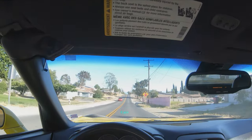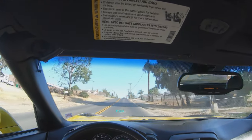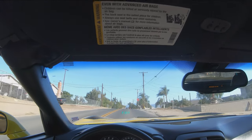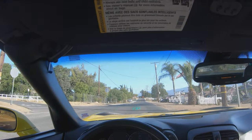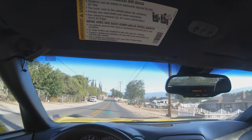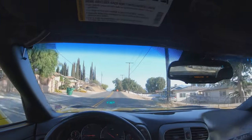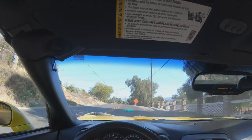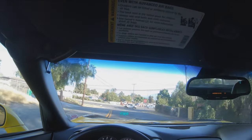I've just been driving it around and one thing I've noticed is just a little bit more pops on deceleration. I honestly think I might need to get a tune soon, because with the intake, the ported throttle body, and the exhaust, I think I need a proper tune. So far it's been pretty good — just a little bit more pop on decel, nothing too crazy. I'm about to do a pull on the freeway in a little bit.